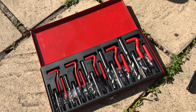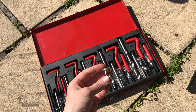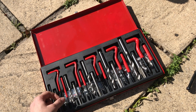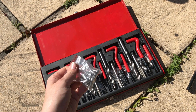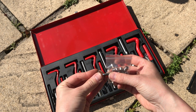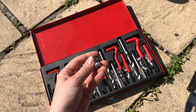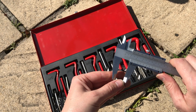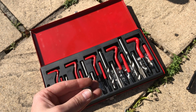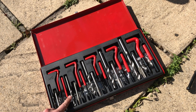Here's the bolt that we need to get the replacement for. There are a couple of ways we can do this — seeing as we've got this kit, we can use the replacement threads here and try our bolt in it to make sure we've got the right size. Otherwise, if you need to order a kit and need to know which size, you can grab yourself a pair of vernier calipers. This is a 6mm bolt, so that means we're going to use an M6 kit.